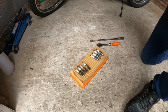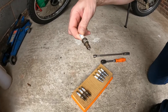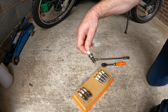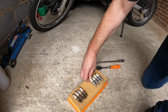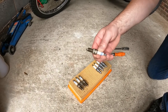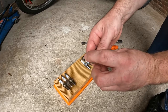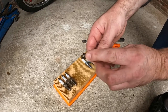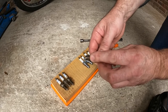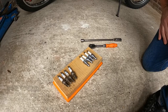So old versus new — these originals were Bosch YR7DC. The dealer replacements are NGKs. In terms of the condition of these plugs, there are no red flags here, they look OK. The gap is considerable — you can see that the centre electrode is worn quite rounded, so they definitely needed doing. One of them's a bit oily, but that's just because of the leaking breather pipe that's going to be replaced at a later date.